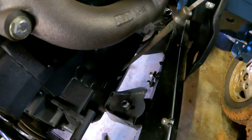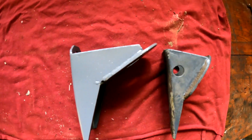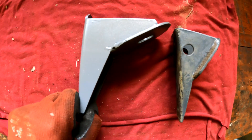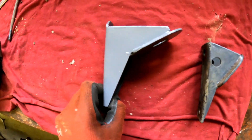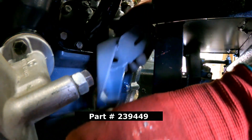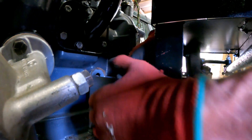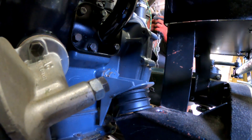Engine mounting points on the block are common, as well as the depth from the mounting points to the rear of the block, but what differs are the angles of the mounting brackets to the chassis. On the 107 chassis, the left-hand mounting bracket is identical and fits perfectly. However, the right-hand side mounting bracket needs to be changed - the angle of the original two-and-a-quarter-liter engine mount is too steep and results in the engine mount being distorted. You need to use the original right-hand side mounting bracket from the two-liter engine. This mounting is the same as that used on the later 2.6-liter six-cylinder engine, with part number 239449, and these mounting points are still available. If you don't use this mounting you are going to have to cut and weld metal to make it fit, which is what you'd like to avoid.